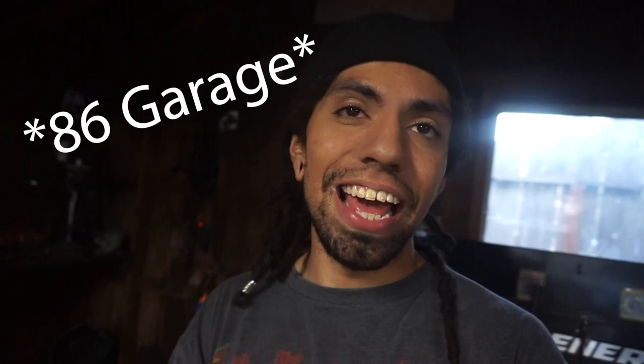So I recently got my hands on the last AE86 magazine, and there was an excellent write-up on how to convert your SR5 rear end over to disc brake. So you guys know me, I already went ahead and got started on getting everything ready for me to be able to convert this over to disc brakes, get rid of the drums. The only downfall to this conversion is your cable e-brake no longer works. You have to either convert over to hydro or figure something out. So let's go over the parts that you need.